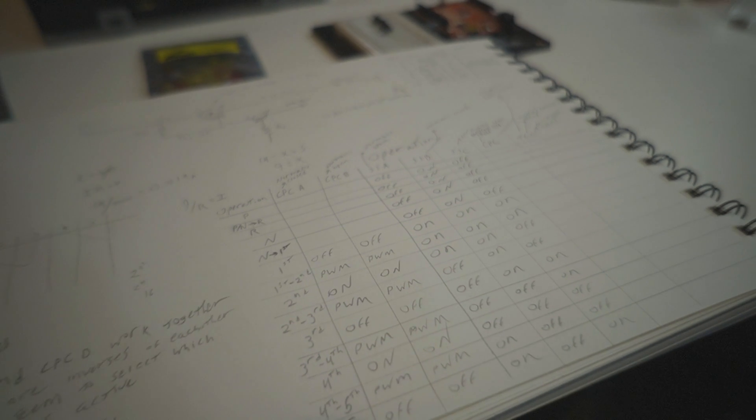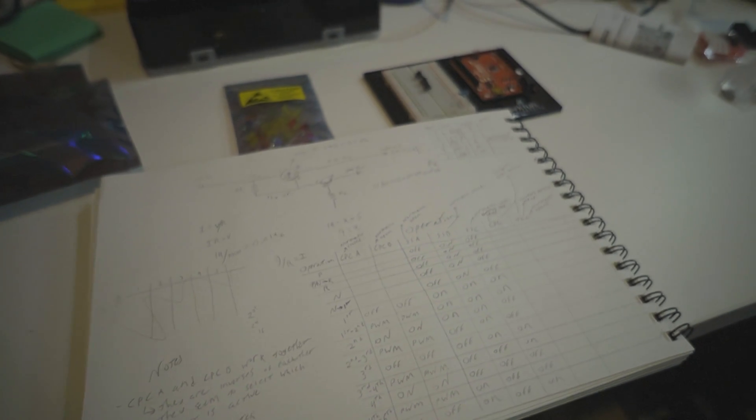I took a look at everything and wrote down a little logic table that shows what each solenoid should be doing in each state — each gear and each in-between gear — so I can reference it quickly later on. Amazingly, all the solenoids just use regular 12 volt power, aside from two of them which are also 12 volts but have an in-between state using PWM, pulsing on and off very quickly. These two solenoids are CPC-A and CPC-B — the clutch pressure control solenoids. They vary how much pressure goes to each selected clutch, pulsing at 240 Hz with a duty cycle of 40 to 50%, which allows for a smooth transition between gears without any sudden jarring.